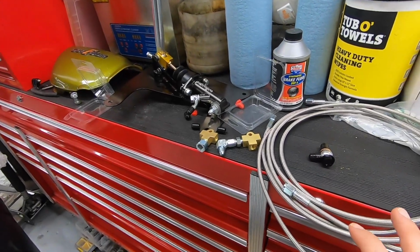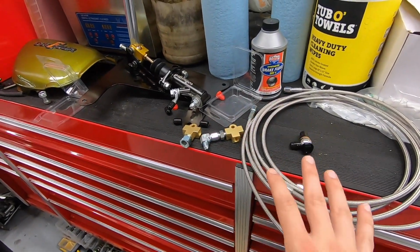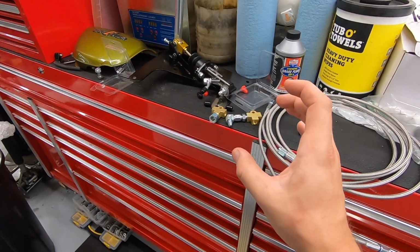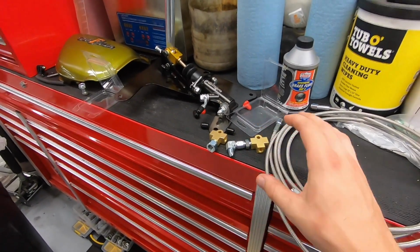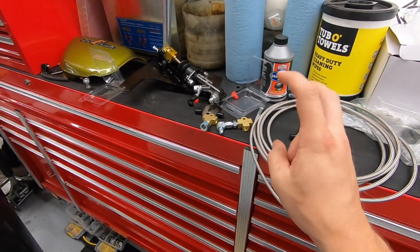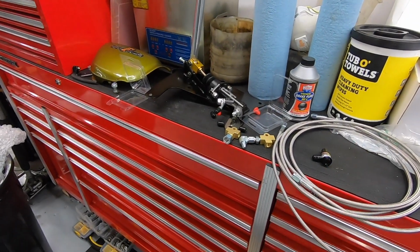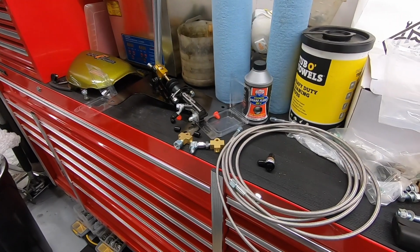I also went ahead and got their ABS delete line kit, which I'll walk you guys through exactly how this works. But basically we're going to be eliminating the factory ABS block right in front of the engine, and that will actually allow us to utilize the factory hard lines to run our rear hydraulic handbrake. So all the brakes and everything should work as normal with no ABS. We yank on this handle, it should lock just the two rear calipers. That way we're not having to fork out a whole bunch of money for an extra caliper setup.